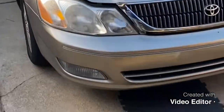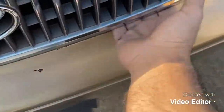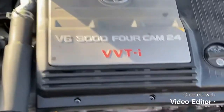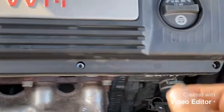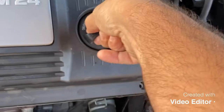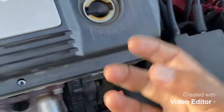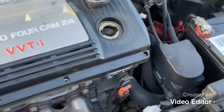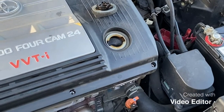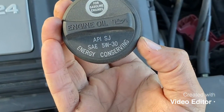First you go inside the car and you pop the hood. I'm going to go ahead and take it off. This is the transmission over here — this is the oil right here. Just pull the stick out and open this up, so that way when you open the drain from the bottom the oil can flow better. You can look it up in your owner's manual for what kind of oil you're using and the capacity. This one is 5W30.